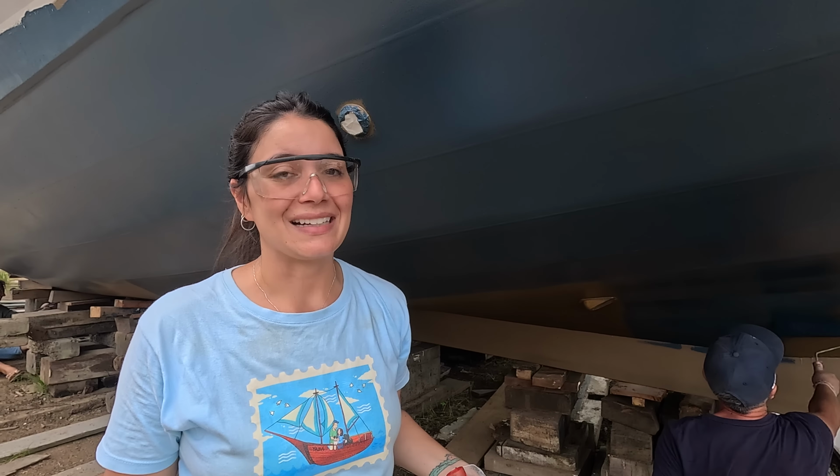There we go. I'll let Patch finish this one and I'll do some stuff on the other one. So much has been done today: the crib, the anti-fouling, the platform supports, and one thing that's really missing on this transom is an exhaust. I have the exhaust tube already, 4 inches, which goes in the same size hose that the muffler is on. However, I need to drill the hole still, and then once I've drilled this hole, I can give it back to the welder for him to finish it off so we can install it.